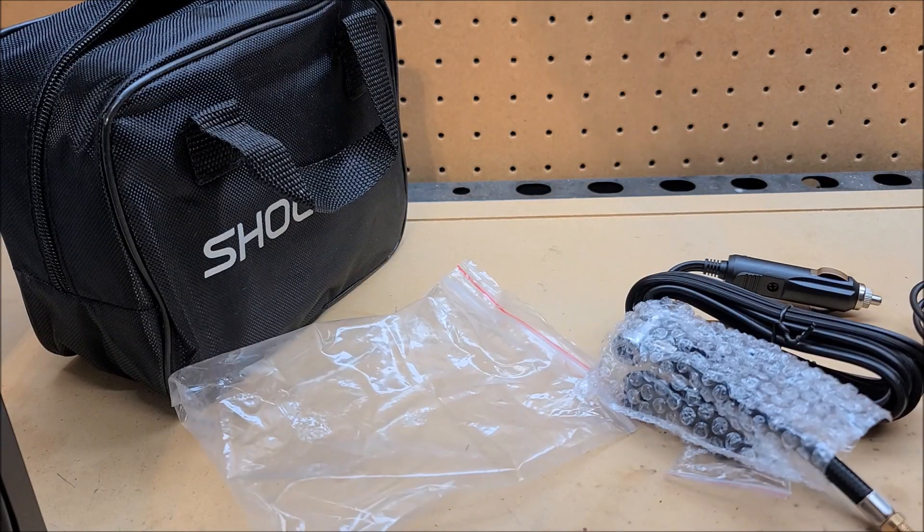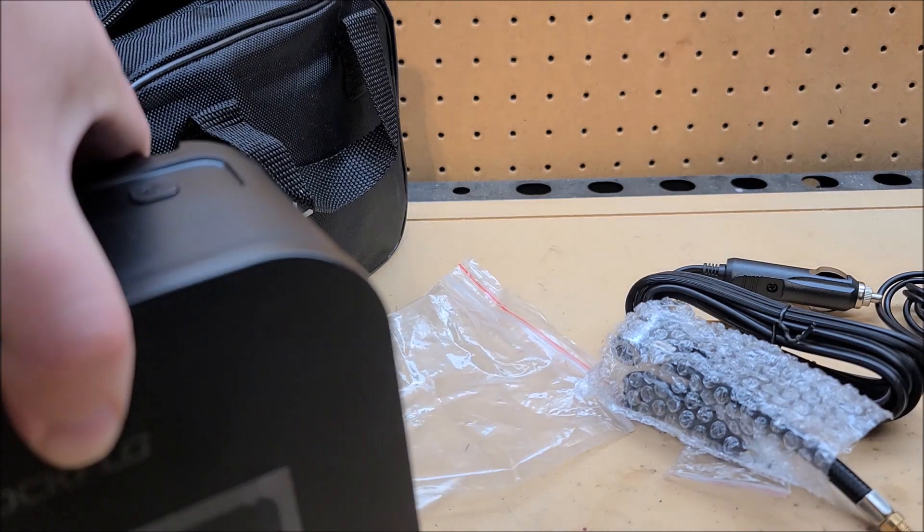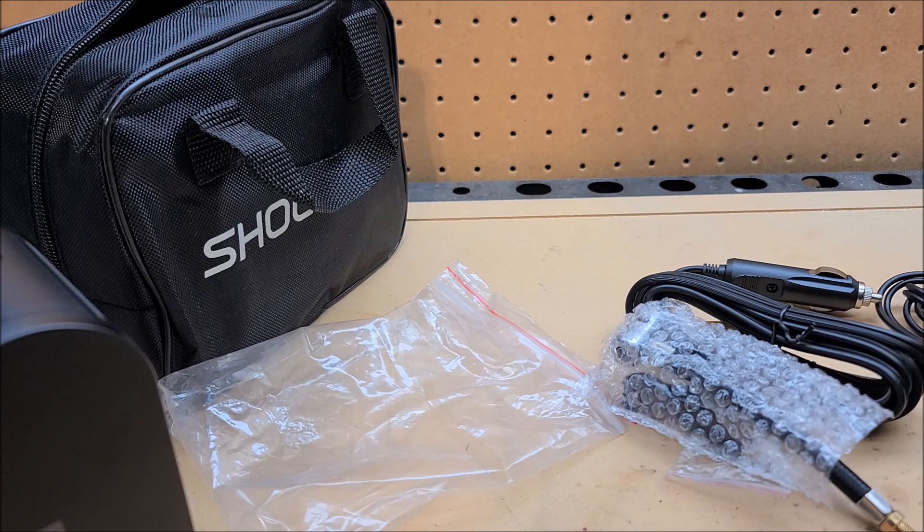So let's go ahead and fill the spare donut tire. I Googled the correct pressure since I've never used this spare before — Google says 60 PSI, and the markings on the tire also say 60 max, so to be safe I'll put it at 50 or 55 PSI. It's just going back in my trunk after this, but it's good to know there'll be air in it if I ever get a flat in the middle of nowhere.